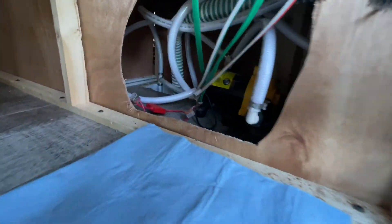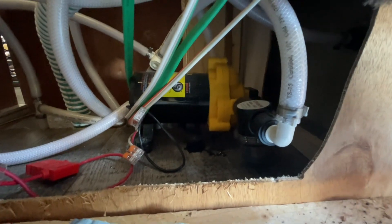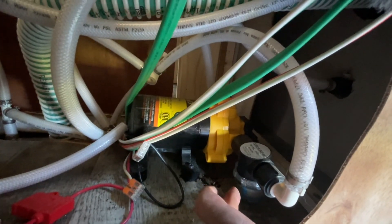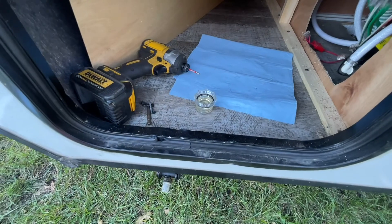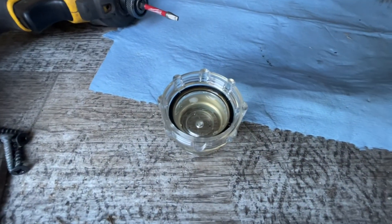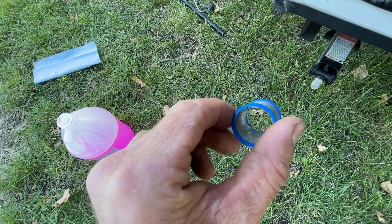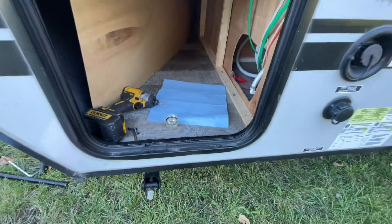Since we don't have any RV antifreeze through the pump right now and we've blown it out with air, I'm going to spin off this filter. The filter base unscrews and there's a filter inside — I'm going to take it all out, clean it out, and put it back together before introducing liquid back into the electric pump system. This one was a lot better than my 21-190. You can see there's hardly anything in the bowl, but when you look at the filter you can see all the crud on the inside — so still very worth doing. I'm going to clean this out, reassemble it, screw it back on to the pump, and then we'll continue with the RV antifreeze.